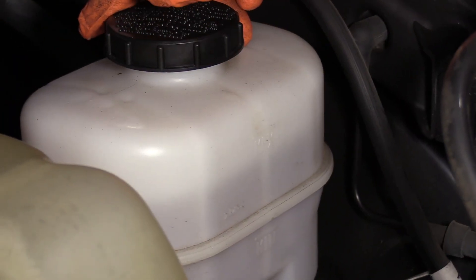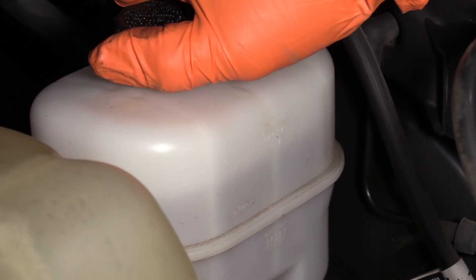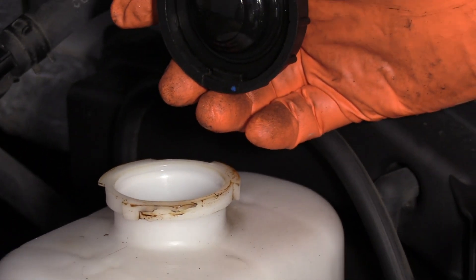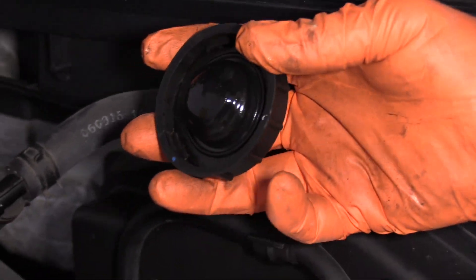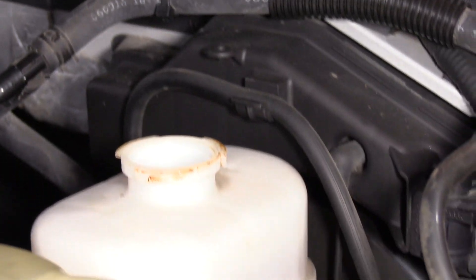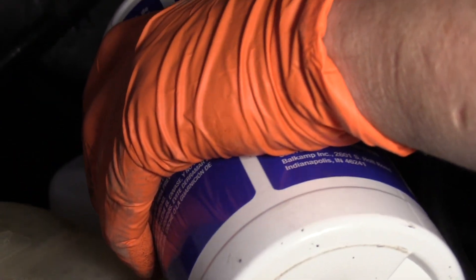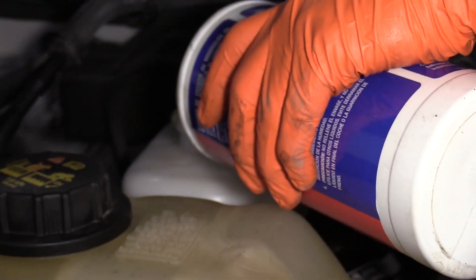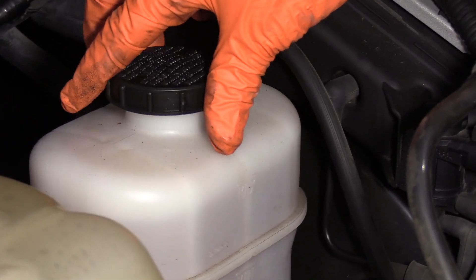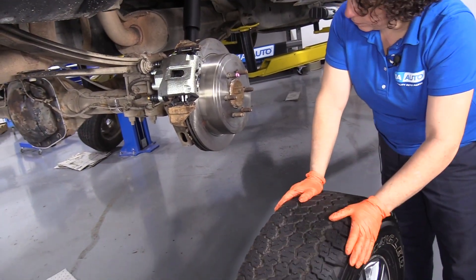Now that I've bled the brakes and everything is closed up and cleaned, come up to the master cylinder. Take the brake cap off — you'll see the rubber diaphragm that got sucked down from the vacuum of the pumping. Put that back in, then top the fluid off to the max line with DOT 3 brake fluid as recommended. The cover is nice and clean — reinstall it, lock it down, and now get ready to put the tires back on.